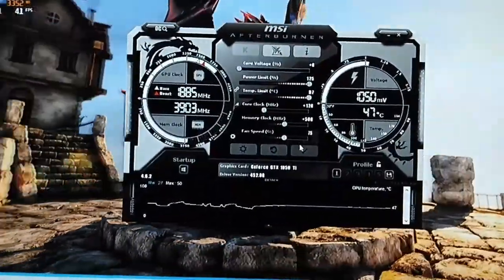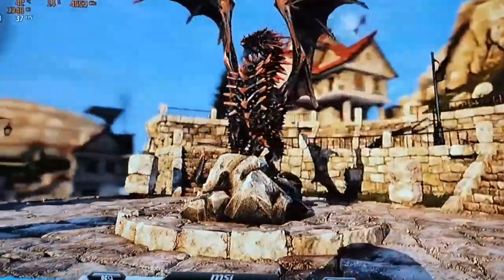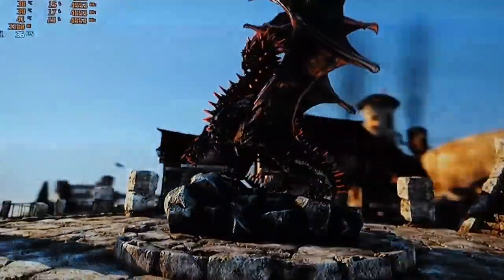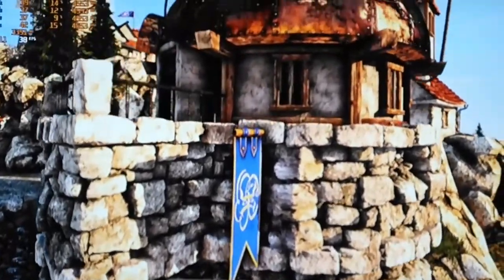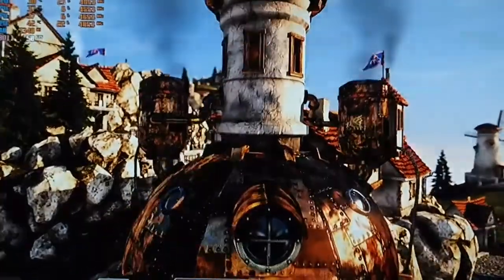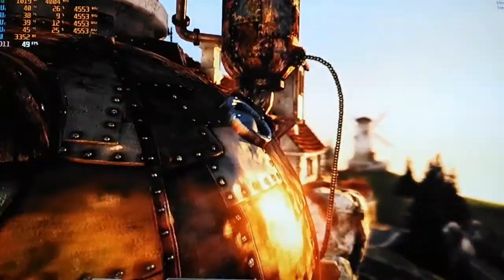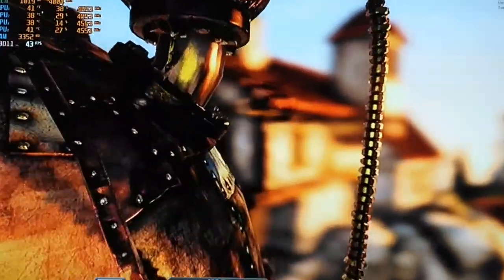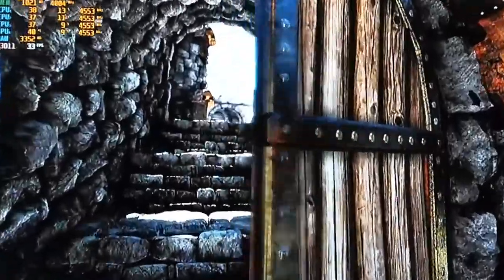Plus 500. Alright. Usually around this range, we might start seeing some crazy stuff. I haven't seen anything yet. Sometimes too, when the memory chips get hot, it'll run fine, and then suddenly you'll just have random weird crazy stuff happen on the screen, and then a whole computer crash or something like that. At least it's happened to me once with a GTX 970. I was running a plus 700 and something overclock, and things got really weird. So plus 500, not too shabby, huh?